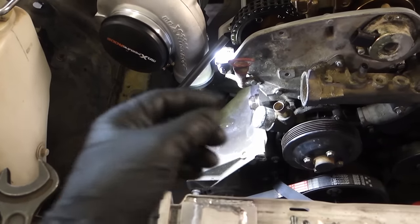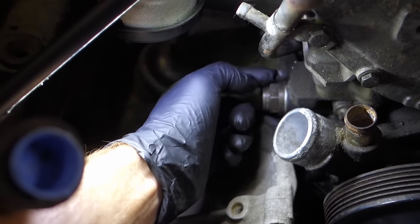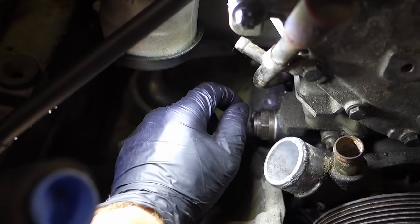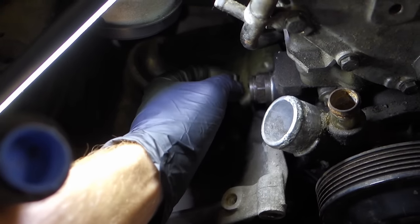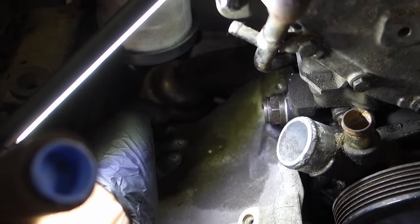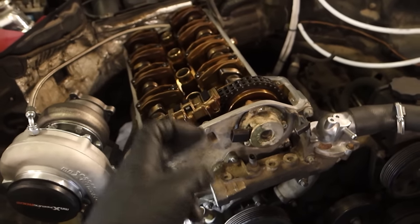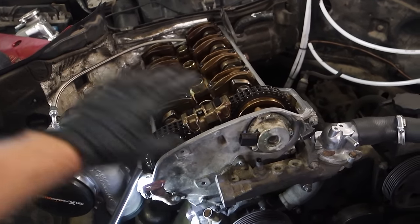Take just the tensioner shell without anything inside, then separately install the piston with the spring, push it in, and install the bolt only after everything is done with timing. If you remove the tensioner without disassembling it and install it back extended and locked, then tighten it, the timing chain will be over-tightened — and there's maybe five minutes until destruction of your engine.